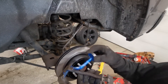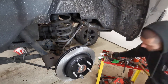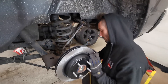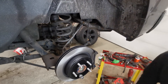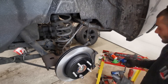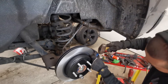Sorry about the compressor noise — I guess it's part of the job. We want to put our bolts with Loctite that hold the caliper holder in place, tighten it up. You always want to finish by hand. Next you want to get your new brake pads — put some lube on the tabs and on the back. Slide them in in the same order as how you removed them — it just slides outwards. Sometimes tolerances can be a little tight.